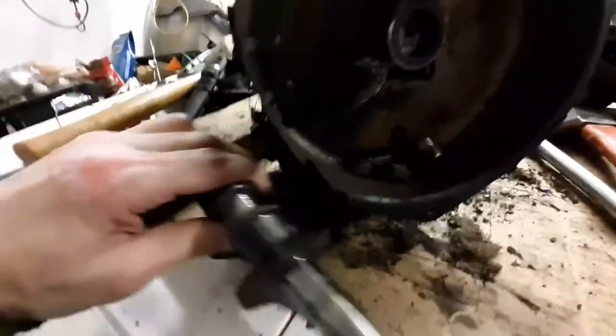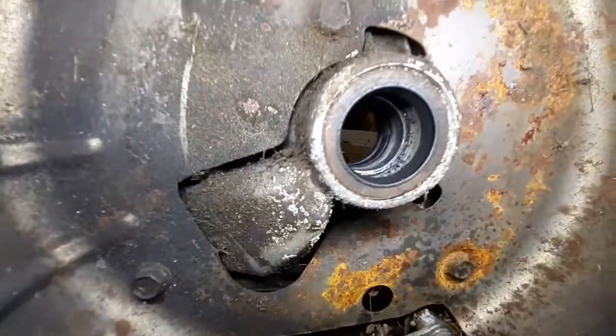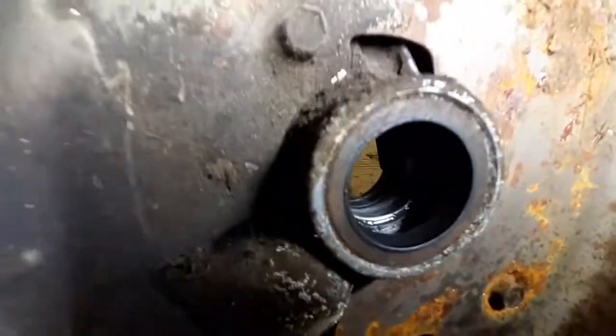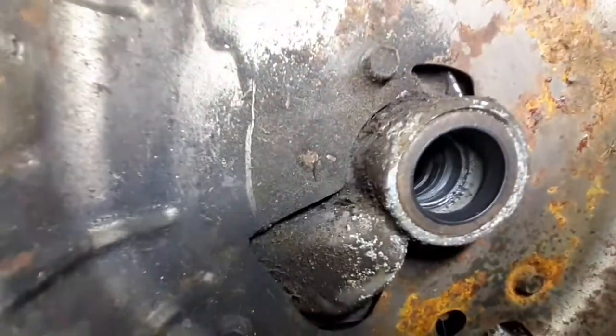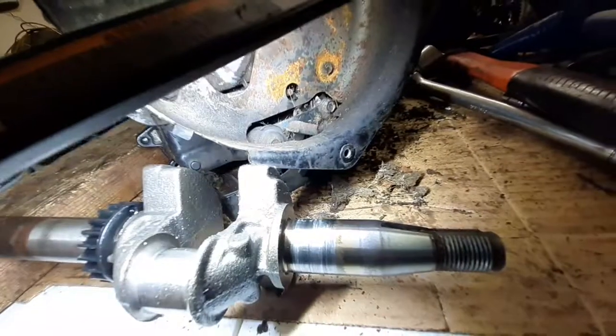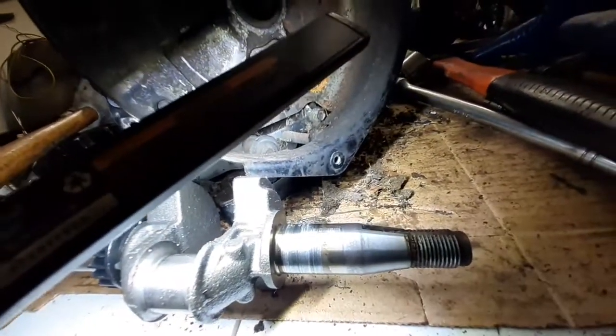The mystery is a mystery no more. The last thing I did was pop the crankshaft off because it was still hard to turn after I took the piston out. You can see how this has actual aluminum transfer, and if you look up in here you can see a lot of gouging right in here. So actually this is top end lubrication failure — it seized up on top. Look in there, you can see the scoring. I've seen this one time before. Somehow the passageway got blocked up, oil didn't get up here, and I could actually smell that this oil had cooked. You can see the discoloration — that gold color right there. It's fine there, no problems here — so it was a top end lubrication failure. Well, we figured it out.